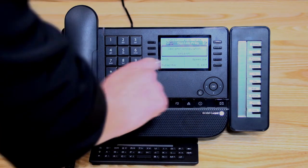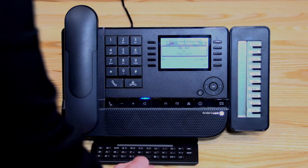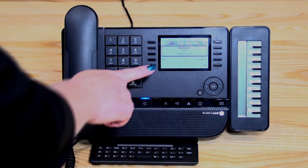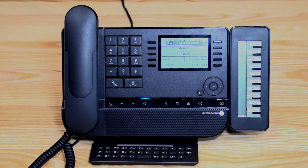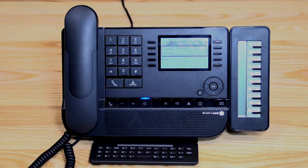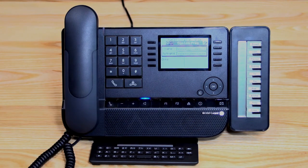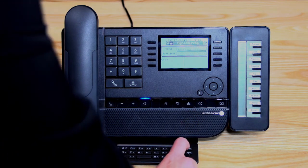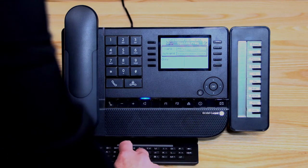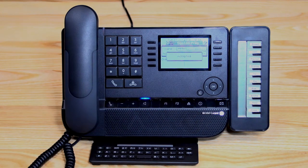Okay, so going into subscriber, I can now change the name, so press subscriber. Enter in the destination who I'm after, so I might enter in Robert. Comes up on the screen, press OK. Press name. Now from here I could clear Robert out, and I could put in the new person that's going to be assigned to that phone. And then OK. Okay, so I've renamed that phone.